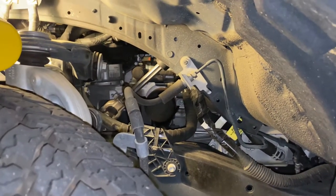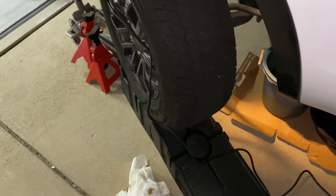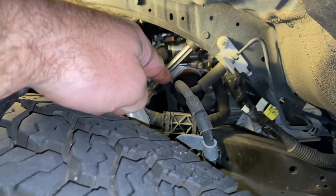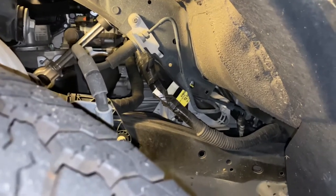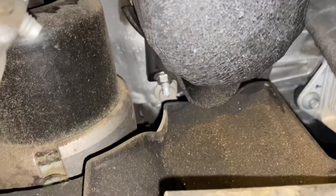I want to try accessing it from behind the driver's side tire. You can see I've got the tire turned as far as it'll go. It's kind of funny — with these plastic ramps, turning the tires actually turned the whole ramp, which is fine as long as it turns back when I straighten the wheels. I'm pretty sure I can reach the oil filter from here without having to crawl underneath and wrench my arm around. There's the drain cup right there that catches any waste once you loosen the oil filter.